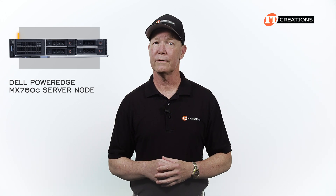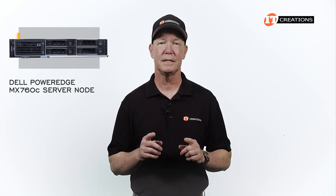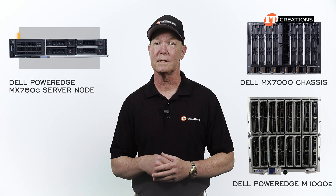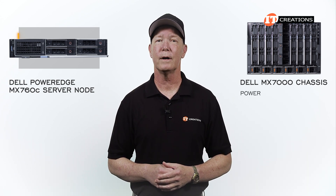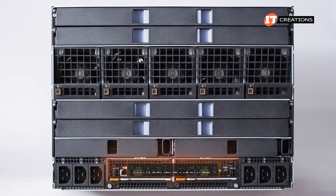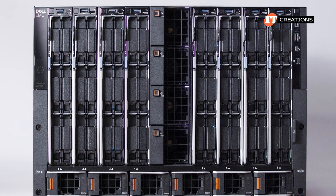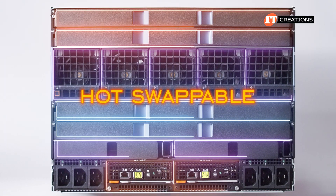Some of you may not want to view that, so here's the short version of the MX7000 enclosure. The MX7000 basically replaced the modular Dell PowerEdge M1000E, which was getting a little long in the tooth but did offer support for several generations of server nodes, just like the MX7000. The chassis supports power, networking, cooling, and central management modules. Highly redundant with dual modules for management, IO fabrics A, B, and C, the MX7000 chassis enclosure has five horizontal fans in back and four vertical fans in front providing cooling. All are hot-swappable, including all the modules in back.